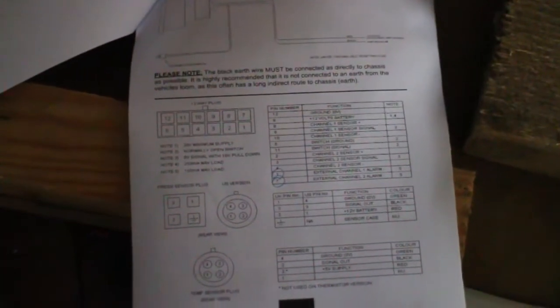Here's the unit taken out and the plug doesn't have any pins in it, so I'm going to have to order some pins and first work out what plug that is. Those pins on the SPA gauge are Molex connectors, so I've ordered some female pins. That means I can add alarms onto pins one and seven — one being channel one, the oil sensor alarm, and seven being the temperature sensor alarm.